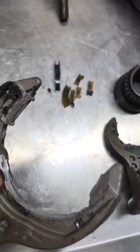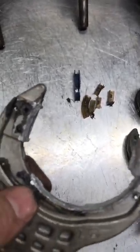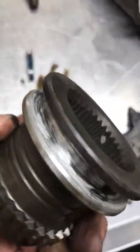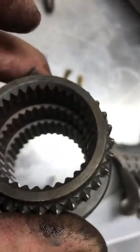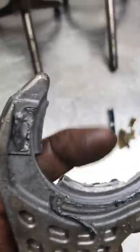This is the front range fork — this controls four-wheel drive high, four-wheel drive low, or two-high. When this runs low on oil and it's riding in here, without the oil it welds the aluminum to the metal and it will not shift in and out. It actually busts past, kind of like this one, so now you're shifting and it's just moving back and forth through there doing nothing.